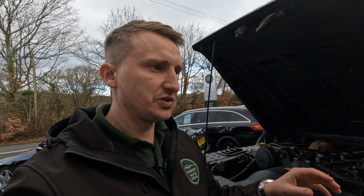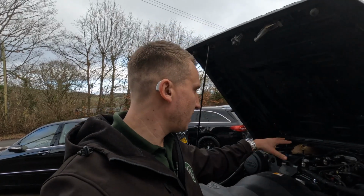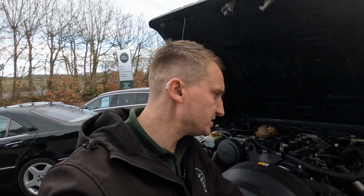And then all I was doing was having all the temperature right up in the cab to try and get a lot of the heat out of the engine bay, and eventually limp it home, so to speak. So I went back into the garage and thought, well, the only other thing it could be is maybe the head, as in the head is split, or a head gasket. That's quite a common thing on these 2.4 TDCi engines.